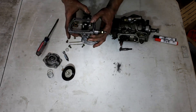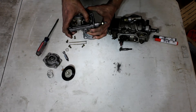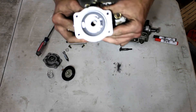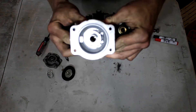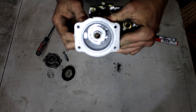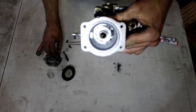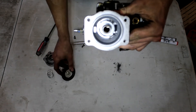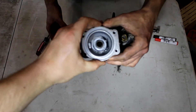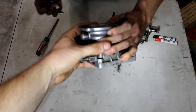Down inside here there's a pin - that pin is what rides on the ramp of the fuel pin. The fuel pin ramp always faces the front of the truck - or more accurately, it should always face that internal pin, which is toward the front of the truck. Once we have these tightened up, we put a Sharpie mark to tell us where the face is at.